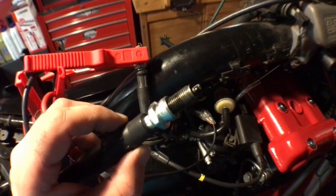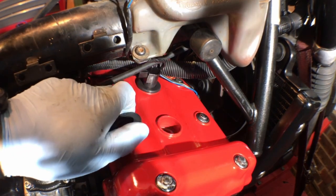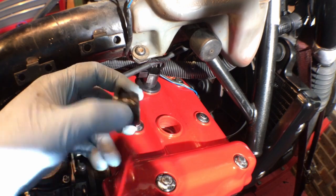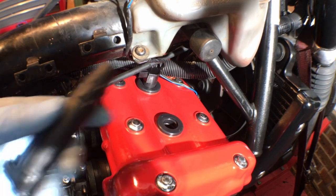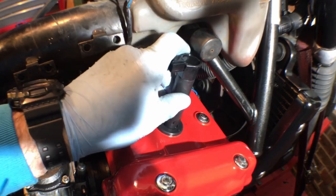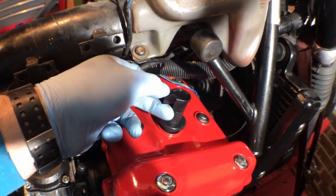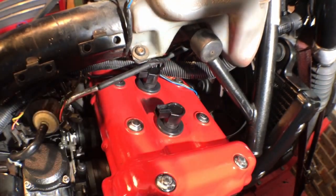Now how do we install the new coils? I've already gone ahead and installed the first and second cylinders, so it's just the third cylinder now. Grab the little seal and squirt a bit of silicon oil on it to make installation easier. You don't have to put too much — just a tiny bit helps it slide in a lot easier. And that's it. If you want to remove it, the seal is probably going to come with it, but just press it back in to make sure the seal is seated and it's good to go.